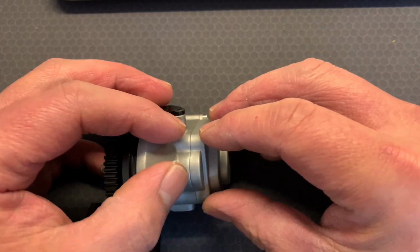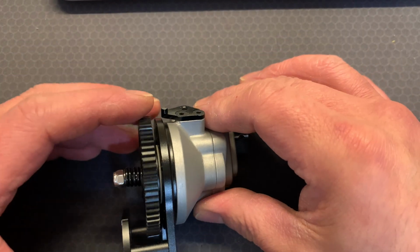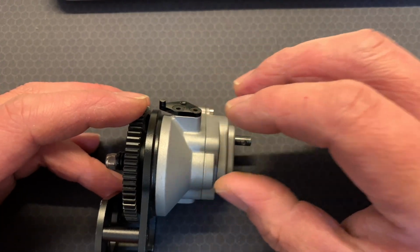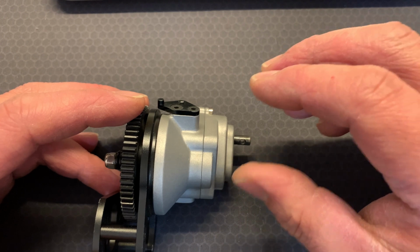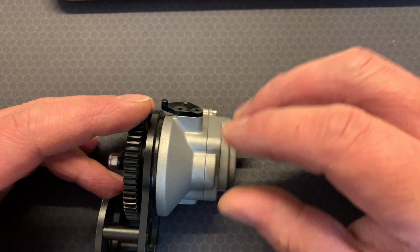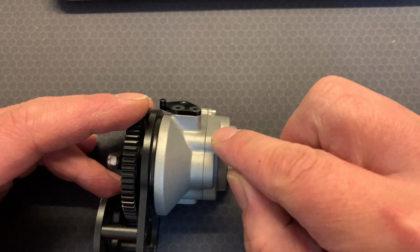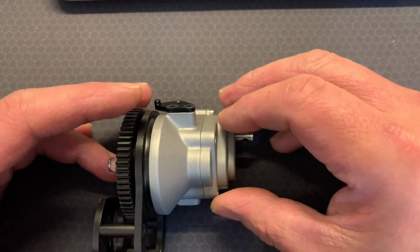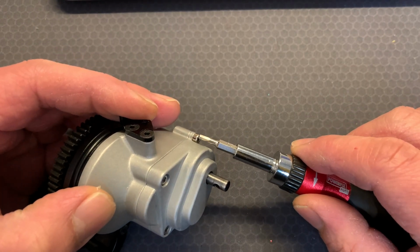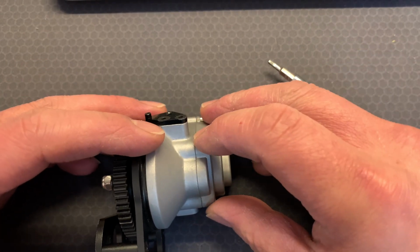These two halves are the transmission case, and when they're screwed together, they hold all the bearings and the gears in place. Now, this transmission is made very well in that it absolutely does not need any shimming, because there is no slack anywhere. The problem is it actually needs to be de-shimmed. Well, not de-shimmed because it doesn't actually have any shims, but the space between everything, the tolerances, needs to be reduced. Because when you put these screws in just very slightly tight, not even tight at all, just nip tight, there'll be a perfect fit.